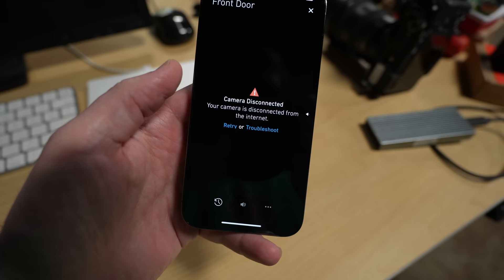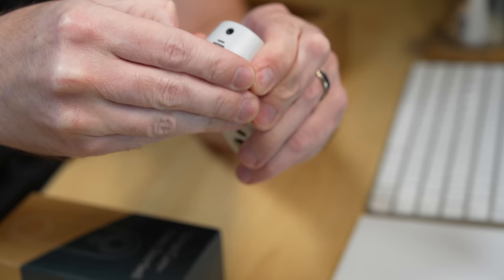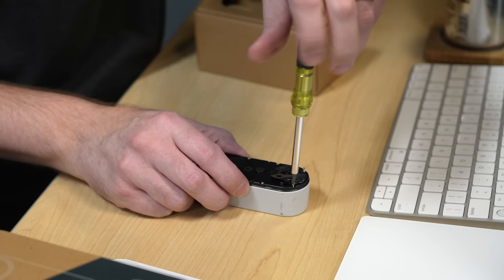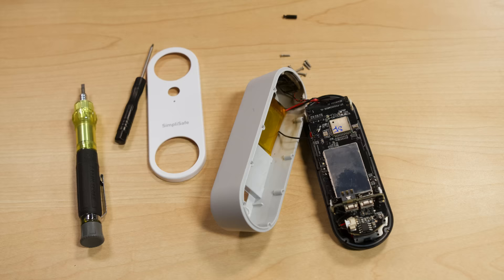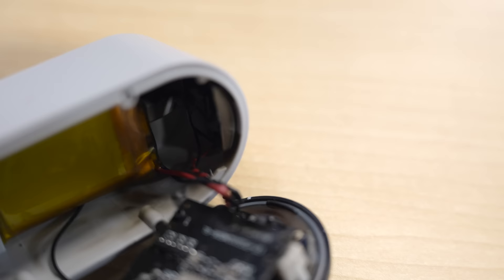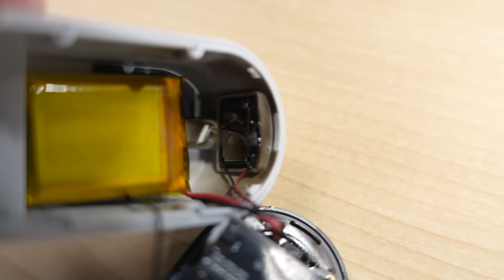I started seeing 'camera offline' in the SimpliSafe app, and eventually I couldn't even press the button — it wouldn't even click. After another day or so I started smelling burnt plastic, so I immediately cut power to the doorbell, pulled it off the wall, and tried to reset it inside. If you do this, have a bucket of sand nearby — there's a lithium battery inside, and fire and lithium batteries don't mix well. I pulled it apart — score one for SimpliSafe actually making repairable units and not sealing them with glue — and was greeted by a horrible burning electronics smell and crispy wires. SimpliSafe wanted the burnt-up doorbell back for testing, so to make it safe for shipping I cut out the battery, buried it in sand, and sent the doorbell back.